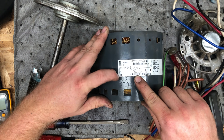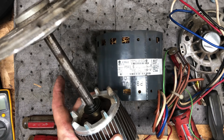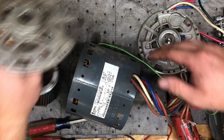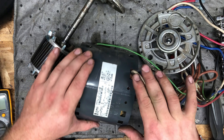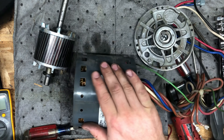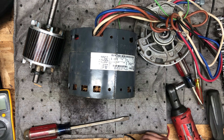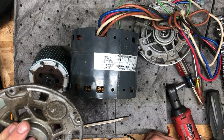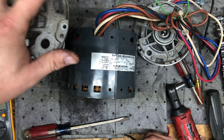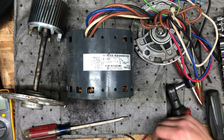1100 RPM, so not spinning super fast. Half a horsepower. Plain bushings — very robust, they last a long time. This motor has probably been in here for quite a long time. It just went out of balance, or the fan went out of balance — one or the other. It kind of makes sense not to replace just one part while you're in there. This runs any time the furnace is on, plus the recirculation fan, so it gets a lot of hours on it. Hopefully someone found that interesting. Thanks for watching.